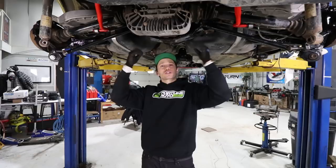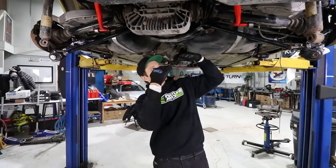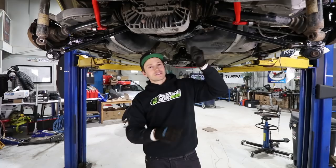There was just too much of an angle that the whole subframe was on, and the metal sleeves weren't lining up correctly. So what we did is we just pulled them out, lined everything up, pushed it back in and kind of pressed it all in together, and it went pretty well. So this is all done.